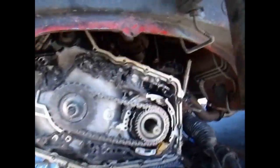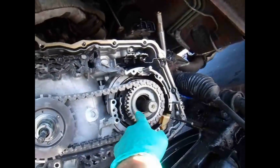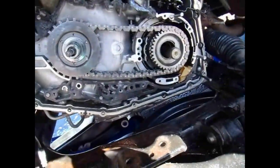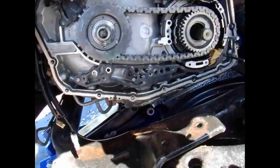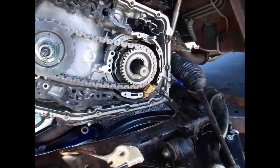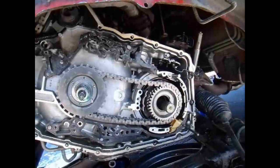Alright, here's part two — Reassembly. You'll want to make sure this washer here is in front of the fourth gear spline. I've got my fourth gear spline right here that I'm going to put on there. Sometimes you'll have to fight with those things for a while. I put some Vaseline assembly goo on the gaskets there to hold them in place, and a couple of bolts I got at Fastenal that were similar to the ones going in there — I just cut the heads off to use as guides to put the channel plate on.